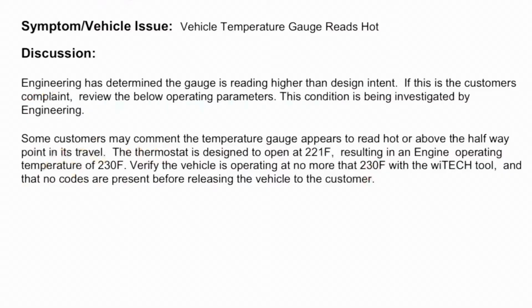There's actually a letter from like the bulletins or a mechanic or the engineer or whatever I'll put up here. It's perfectly normal. And a lot of people have a hard time accepting that, because the way I grew up, that's overheating to me. And honestly, it's not overheating. It's actually the way it's designed. It's got aluminum heads and it's an aluminum block, and everything's expanding at the same rate. And honestly, by now, if it was overheating, I should have blown head gaskets a long time ago, because I have two Pentastars, and honestly, they both run the same way.